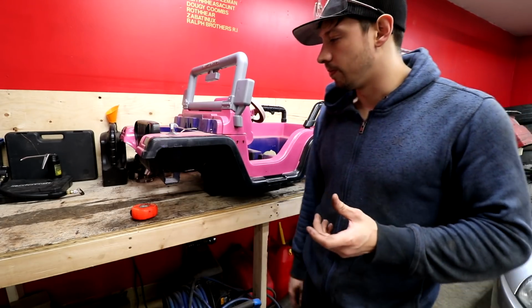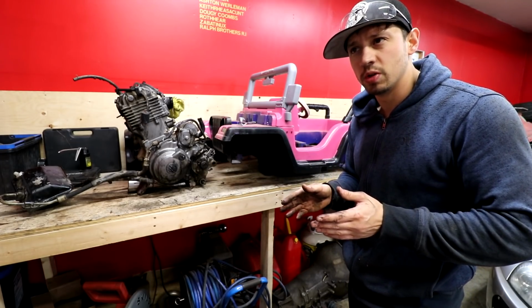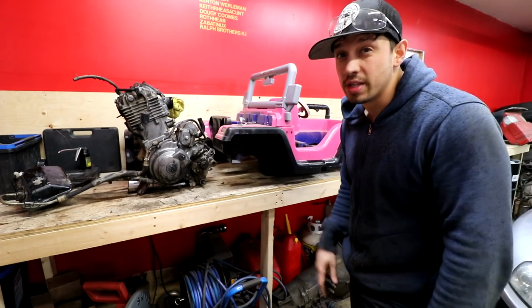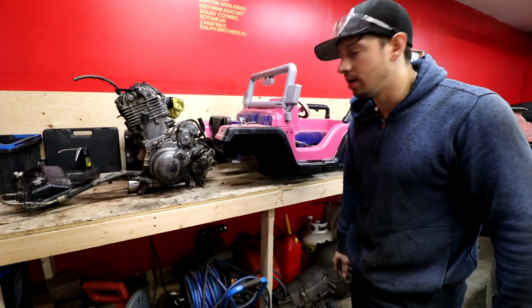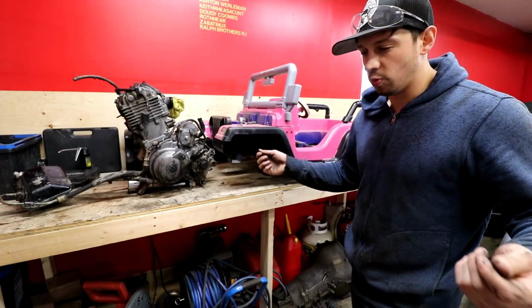And the front is gonna be tubed by itself also. So I'm thinking like dual frame rails out of square tubing, square pipe tubing, I don't know. But like 1 inch by 2 inch, like a 1/8 inch thick or something maybe. I'm not really too concerned about how heavy it is. I just need it to be strong because we want to push cars with it. And then maybe build all the accessories in like 1 inch tubing. So like anything else that we need to build off it, we'll build it in 1 inch.